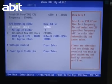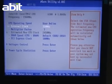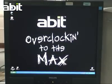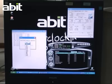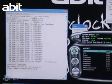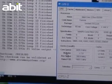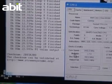Now we adjust the external clock to 350 MHz and see what is happening. SuperPi is utilized by many overclockers to test the performance and stability of their computers. The fewer seconds it takes to run SuperPi, the better overall performance the CPU is running at. After tuning the external frequency, we can see the results — it is almost 7 seconds faster.